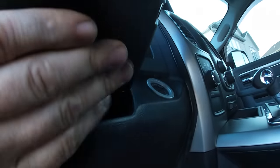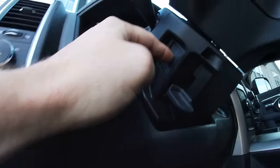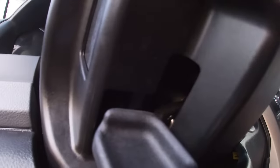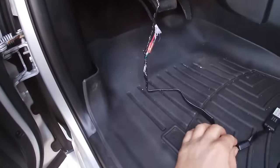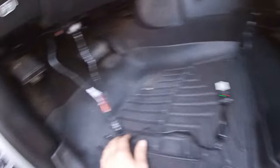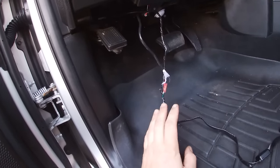The wiring harness goes up here into the back of the steering column. I'm not sure why it goes to the back of the steering column — the ignition switch is over here. I followed the wires and they don't go over to the column from what I can see. It actually looks like it goes up right behind this little blank spot — there's a little gray piece right there — that's where the wires go. So I'm going to take that down, remove the tracking device system to the best of my ability, wire it back up factory, and see if it starts the way it should.